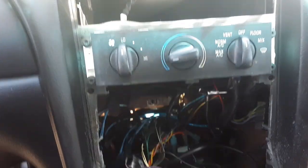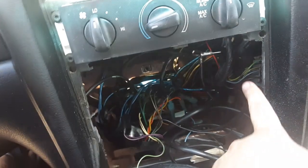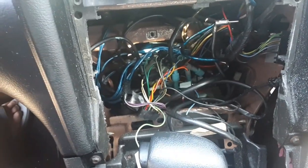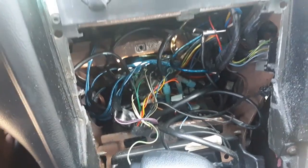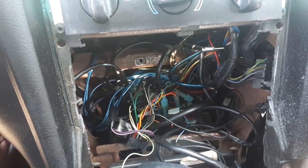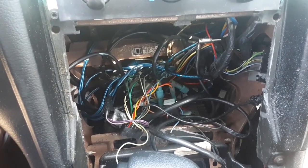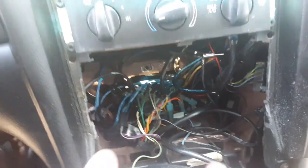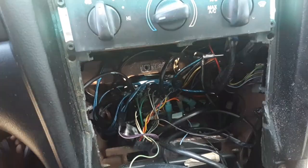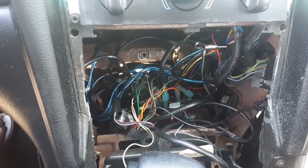To put a double DIN in a 94 to 98 car, you have to cut off the tabs where the old one mounted. Just take a Dremel or something and cut it. It's not a huge deal, and it'll snap in. PM Performance has a good video on this, so I'll put a link in the description if you want to go see what you got to do. I'll let him show you the right way.